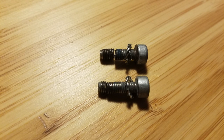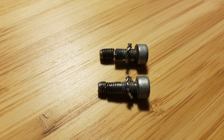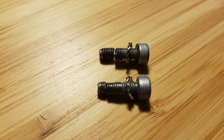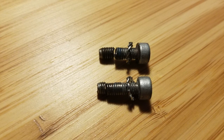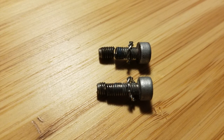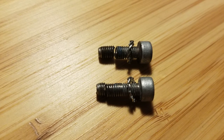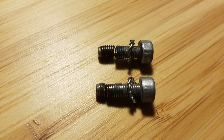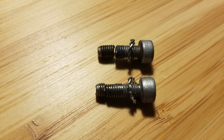The next day, I spent another three hours drilling out the other half, which was much more difficult because it's deep inside the hole and very hard to reach. I broke two small-diameter drill bits in the process, but eventually it did come out. It's amazing that I was able to remove it. In some cases, if this happens to you, you're not going to be able to get the screw out — you will just destroy the only way you can attach a front bag to the frame.